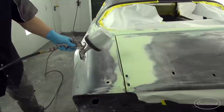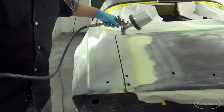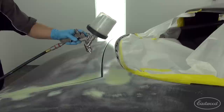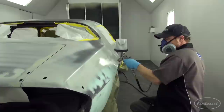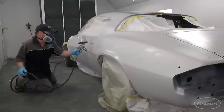Don't forget your mask. Spray technique with a high-build poly surfacer is very different than paint. Your gun speed is slow, your overlap is about 75%, and you're fairly close to the substrate. Take your time spraying and don't worry about stacking the primer surfacer — that's what this stuff is made for. You won't get pinholes and it will rarely ever run on you. When priming large areas of a car like this, you're not concerned so much about overspray or keeping your wet edges down. You're focusing on the panel you're spraying and then moving on to the next one — zone priming while priming the entire panel. Keep in mind that a good portion of this surfacer is going to end up on the floor because it's not paint, it's body filler. You just happen to be spraying it on the panel.